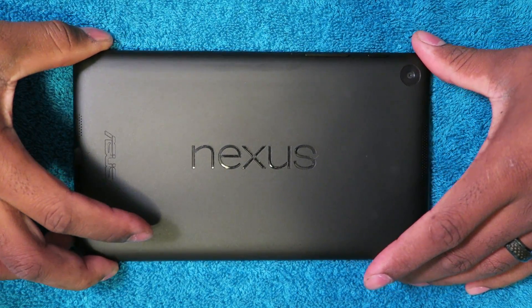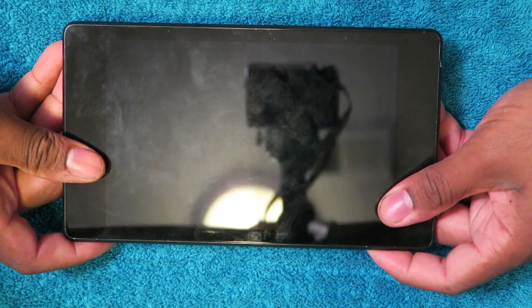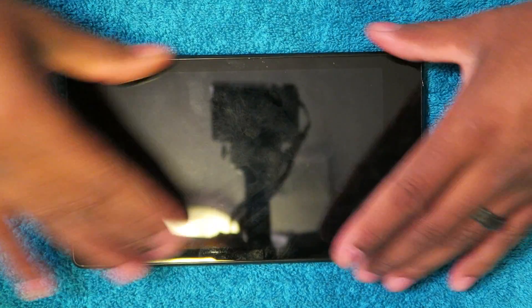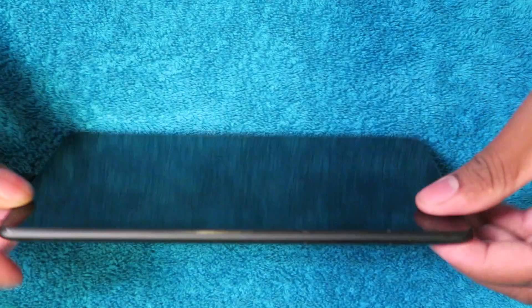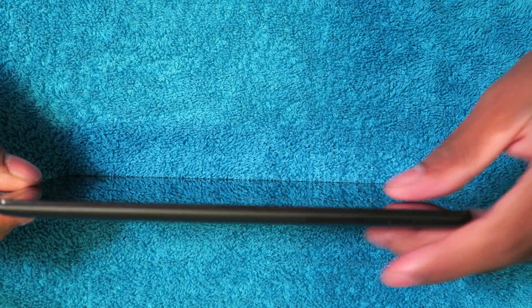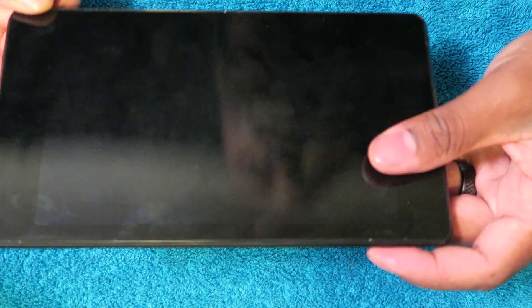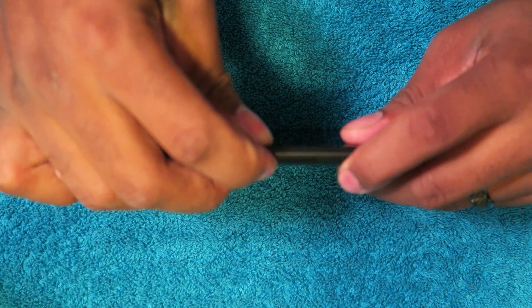I have the Nexus 7 2013 right here. It's not turning on. The thing's been charged up, on the charger for hours. I felt it was warm to the touch, and for a second I was able to get it to come on — the battery showed like 97-98% — but I still was not able to get it to stay on. The screen came on for a second but I couldn't unlock it, went right back off after 10 seconds. It has power but I tried holding the power button, tried getting into the bootloader by holding volume down then power, volume up then power.